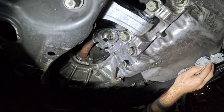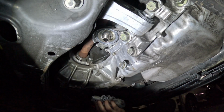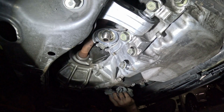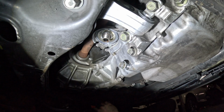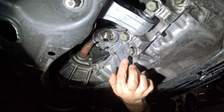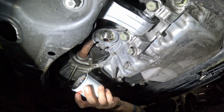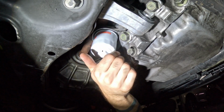Giving everything just a little wipe, you know, it's not going to be perfect down there, it's the bottom of your engine, but once you're all done there, yeah, wipe some other areas. If you see things building up, you want to wipe them down so the next time you do your oil change, you can see if things are still dripping, to know if leaks are starting to begin or happen, or you can just monitor them and just know that, hey, I'm leaking a little bit from my tranny seal here, I'm leaking a little bit from over here, and you can just know what's coming up.